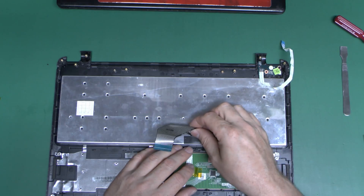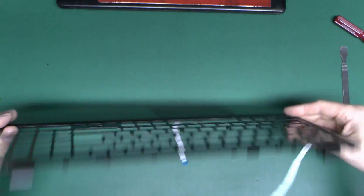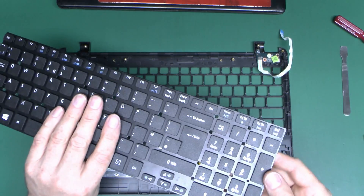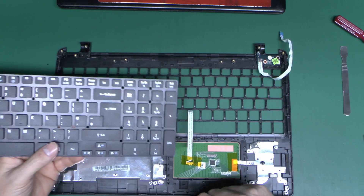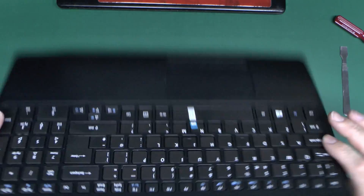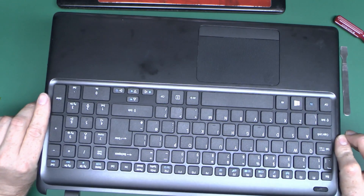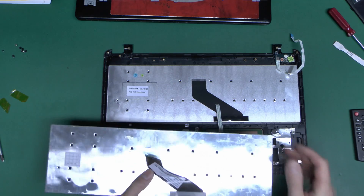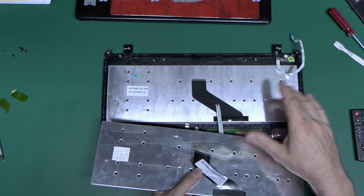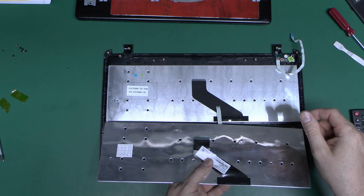And then finally we've actually got here to the keyboard itself. We'll get rid of that one, and then this is basically just a plastic shell with the touchpad permanently mounted in there. Here's the replacement keyboard, and you see it just fits through the various plastic holes. So it's a question of placing it on here and it just drops through — there we go, it shows through the other side. Just make sure that wire is not trapped in there — yes, that's fine, it seems to fit. It certainly looks the same as the other one did. This was sold as a genuine Acer part — whether it is or not is anybody's guess. It's highly likely it was made by some other company anyway, but it certainly fits in and looks pretty much the same.